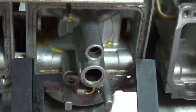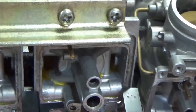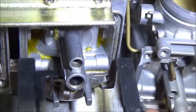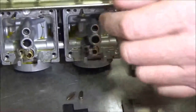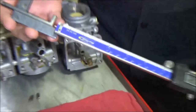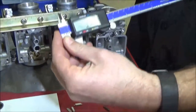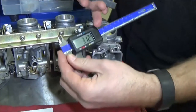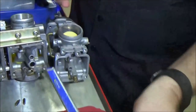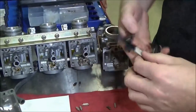I can't get down to that actual mating surface to get a true measurement. So my choices are: if I'm going to use a tool like this, I could go ahead and measure the depth here and then subtract it from my preset measurement. So if my float bowl setting is 12 millimeters, I would need to take three millimeters off. Can you imagine how far off your float height would be? If I'm supposed to be at 12 but I set it to 12 with that lip, I'm really adding three millimeters — I'd be at 15 millimeters. I'd be a mile out in left field.